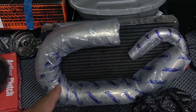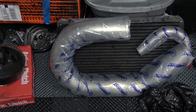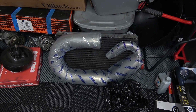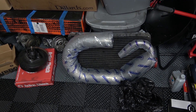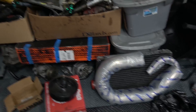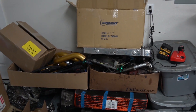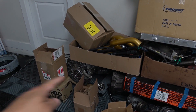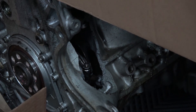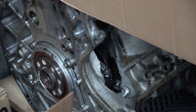This giant tube right here is a four-inch exhaust. I'm gonna make Adam a four-inch downpipe all the way turbo-back, four inches to the tail at the bumper, so it's gonna scream 2JZ all day. These are also some of the old parts from Nicole's car, from when we took in the broken SR — with a little hole on the side. Just a small little hole, you know, just more ventilation.